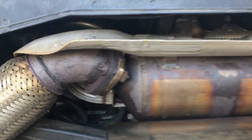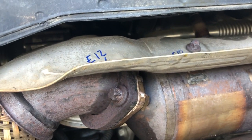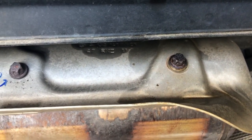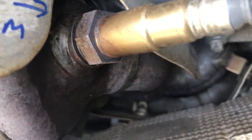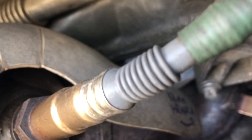When you get up here, there are several fasteners to take off. There's two right there, one on either side. That's an E12, which is what you'll need to take off the bolt that holds the catalytic converter to the lower part of the exhaust. Then up on the top there's a heat shield — those are E10 sockets. They're a little fragile and can get rusted, so make sure you have the right socket and put a little bit of PB Blaster on there. And then there's a lower shield at the bottom of the header — there's a couple, two or three bolts you've got to take off. The header uses a 12 millimeter hex head.